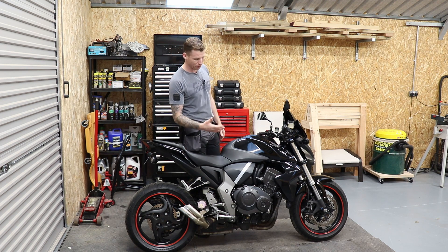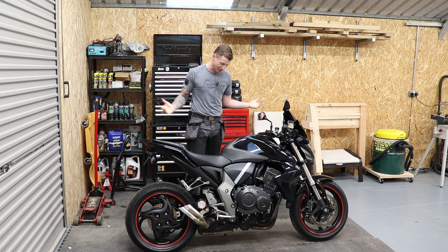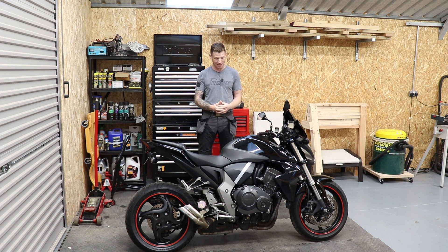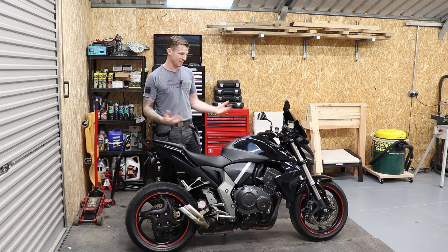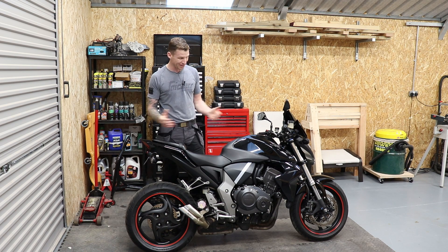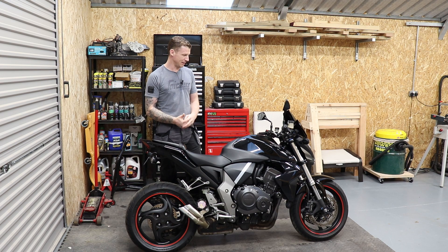It's a detune from the Fireblade engine, down to 135 brake horsepower. It has nice little stubby Ixel exhausts made in Italy, and it's essentially a naked sports bike. It has the Fireblade front end and Fireblade forks. The 2006 Fireblade engine had a longer stroke, so it can be tuned for more mid-range, which is exactly what they've done — loads more mid-range and low-end grunt. It hasn't got the top-end of the Fireblade, but on a naked bike you don't need all that. It's a 2010, wasn't that expensive — the insurance company forced my hand, but I'm pretty happy with it. It's pretty quick, pretty powerful, and a lot of fun to ride.